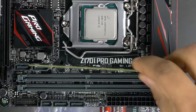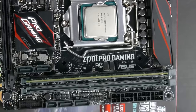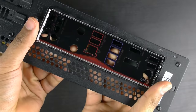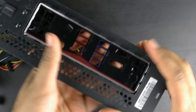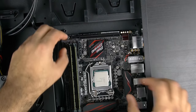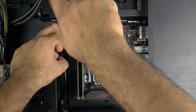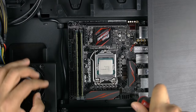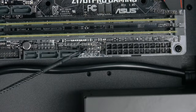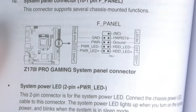Next, take each RAM module and lower it directly into the socket. Everything should align based on the proper orientation, and we're going to occupy both slots since there are only two slots on this motherboard. Then take the motherboard backplate and install it onto the back of the case. Once properly inserted, lower the motherboard down into the motherboard tray, aligning it with the four screw holes, and screw everything into place — those screws should be provided with the case. Once secure, install the front panel header connectors into the motherboard and refer to your motherboard manual for exact placements.